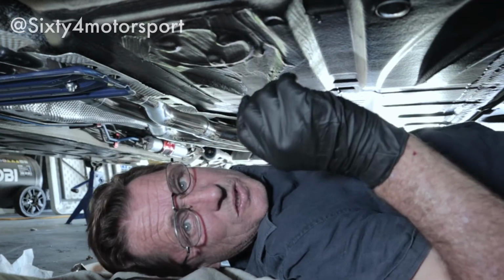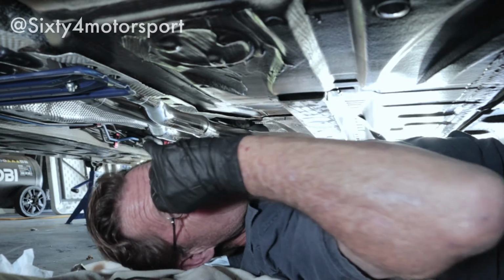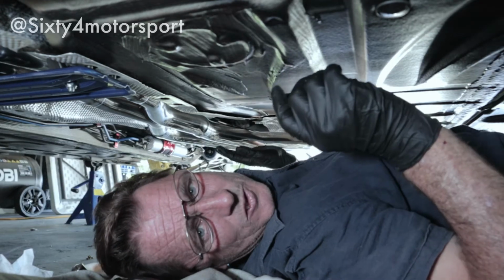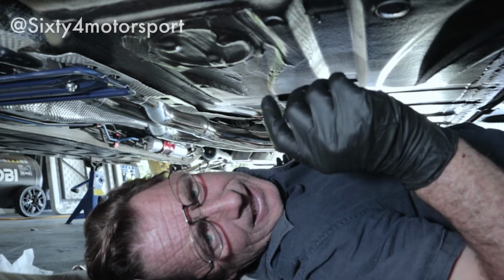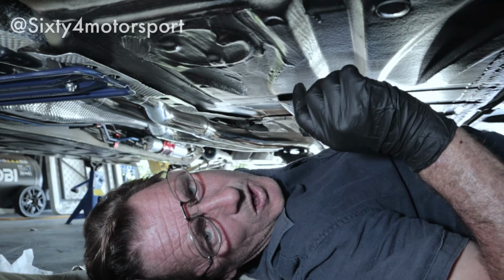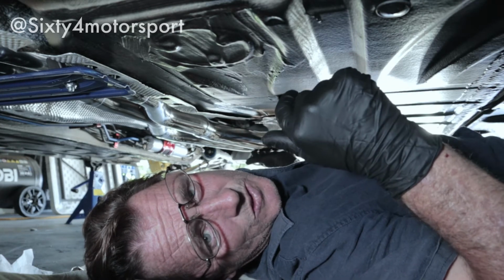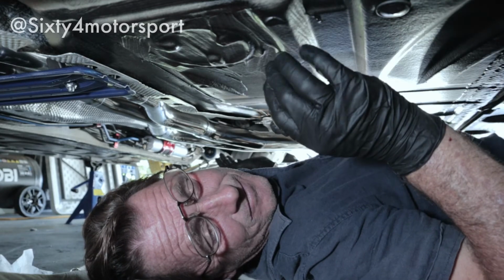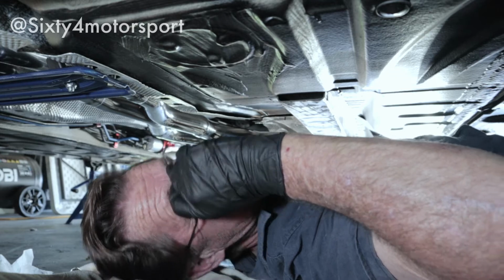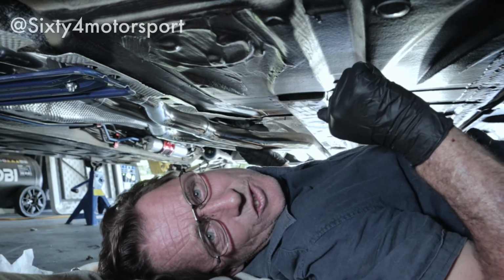I've got the four bolts securing it to the exhaust manifold therein, with gaskets, of course. Now, one of the problems I do have, which I've just realised, is the clamp that secures the exhaust pipe to the support bracket that comes off the gearbox. I chucked it out with the old exhaust system, not realising that it's a separate part. I'm going to have to jump online and get a new one ordered from ECS Tuning.